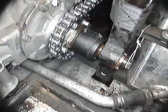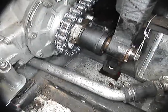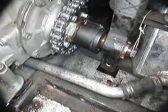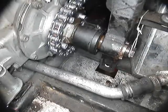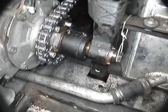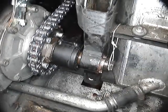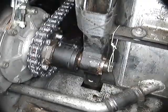We can see that the trunnion pins for the swinging arm have been screwed into place, all the slack's been taken out, and they've had a half turn to pre-tension the tapered rollers. The stainless steel locking rings or nuts have been replaced with mild steel ones, which will not gall up and weld themselves onto the pins or the trunnions. And to make sure nothing goes amiss, the end of the trunnion shaft itself has been wired to the chassis member, or the support from the chassis that holds the petrol tank up.